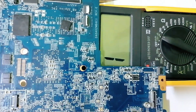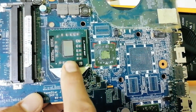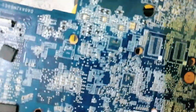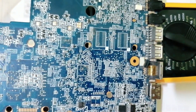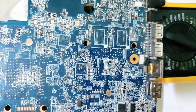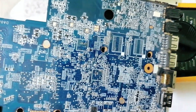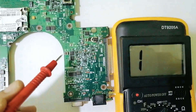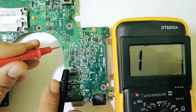We get a very low resistance. Please remember: for chipsets — the CPU, the graphics card, the northbridge, and the ICH — the ceramic capacitors located at the back of the chipsets will always show a very low resistance. This low resistance is NOT a short circuit. Many technicians see this and try to find the short, but it is completely normal. However, for ceramic capacitors not belonging to a CPU or chipset circuit, you will find a normal reading.